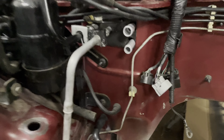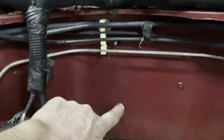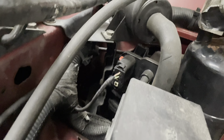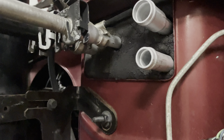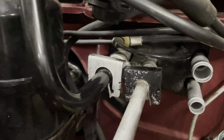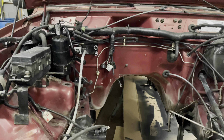We've got everything back together. If you've never had one of these heater boxes out, there's five bolts holding it in — one, two, three, four, and then there's one tucked way back in the corner that I get with a long extension. It went back into this hole here, and you can see we've got new evaporator core and heater core pipes coming out. We've reconnected these lines and we are ready to officially start going back together with this project.